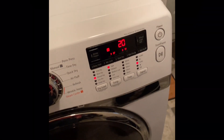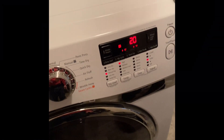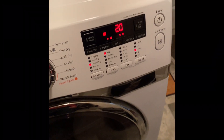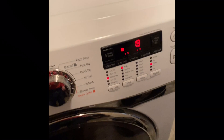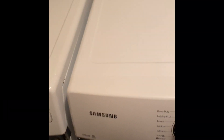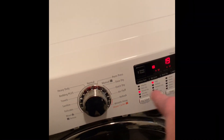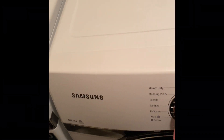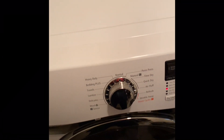So we replaced it. Bought a used one on eBay for $25. They want $236 for these if you want to buy a new one, but I bought a used one. Very simple job to put it in. You've got your two screws back there. The top slides off. Panel drops down on the front. One little plug, one clip, one plug. Eight screws hold it in. Pull it out. Your control button just pops right off there. Reverse the procedure putting it together.